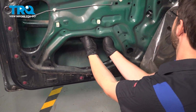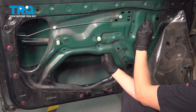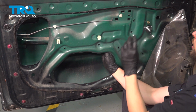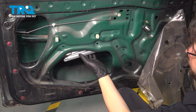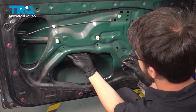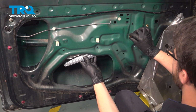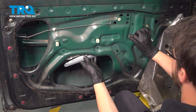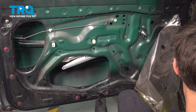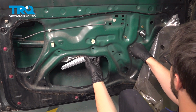Try to line it up with all of the mounting holes. The easiest part is to line up the crank area. Have one bolt ready to thread it in. This will prevent it from falling back down, except for here, but you can hold it here and then line up the mounting holes on this side. I'm going to start in another mounting bolt over here because it lines up. And the last one down here, last one on this side, that is.